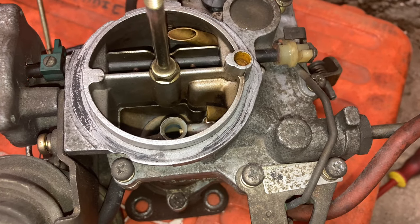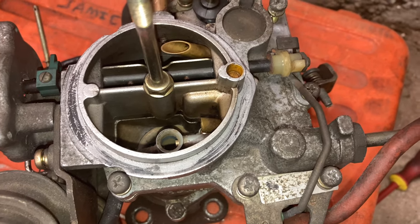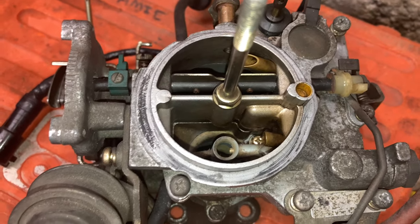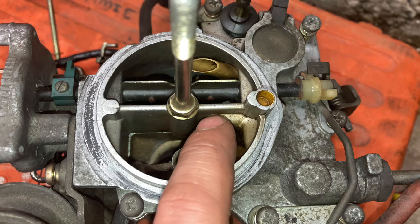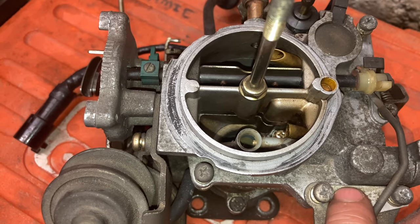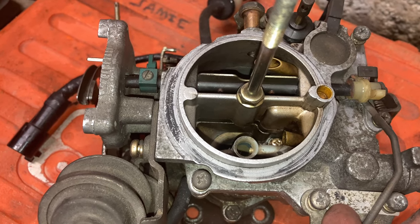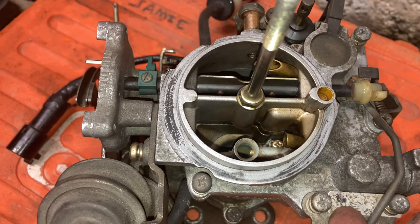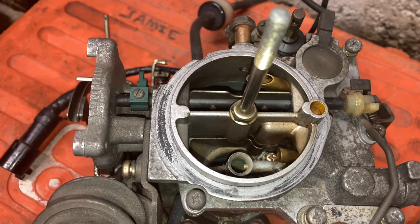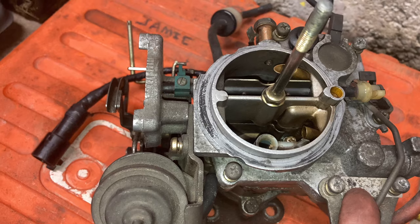With the carburetor disassembled, it's a good opportunity to get in there with some carburetor cleaner. Clean out the float bowl, make sure there's no residue or sediments in the bottom — anything like that can get sucked into the jets and cause havoc. Even if the carburetor is still assembled and you don't plan on opening it up, just spray carburetor cleaner all around this area, get all the varnish off, and that does improve things. I've never really found these carburetors clog up on their own. The only real issues I've found are just cold start performance — they run fine when warm, but if idling rough, a good cleaning will help. With cold start performance issues, it's generally all to do with the choke and the fast idle, so simply adjusting that as shown in this video can make the car run a lot smoother when it's cold. I hope this video is helpful — thanks for watching.